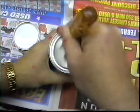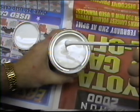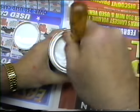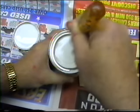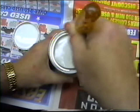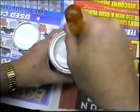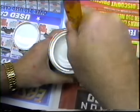Okay, now you notice with Rodak primer, and I want to put this on the tape because this is a key thing a lot of people don't realize yet. A lot of the fillers are in here, and this is a very high grade aircraft quality primer. So you want to spend, again, some reasonable amount of time stirring it, because I make my concoction for brushing. Now the retarder makes it take about five times longer to dry than if you use thinner, but you get a tremendous advantage in the adhesion.